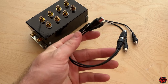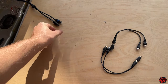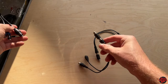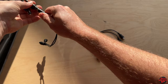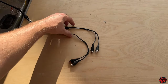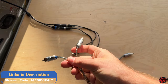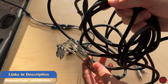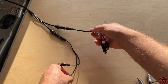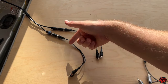Let's focus on the Y-splitters first. This is once again coming from the aftermarket stereo RCA bass amp from the front. All you need is a Y-splitter — two of them, from the male-to-female end on the left side and one for the right side. You usually have a left and a right, so you'd have your male-to-female end on both of them for your left and right channels. Then you can run RCAs to both of them — here's going to be my first set of RCAs and here's going to be my second set. I'm using some six-foot RCAs; you can use three-foot, sixteen-foot, whatever works to get from point A to B. The concept is very simple for a two-amp system.